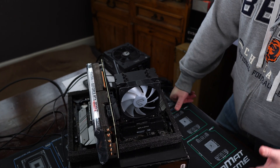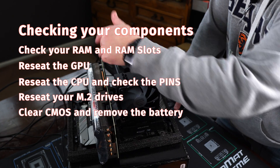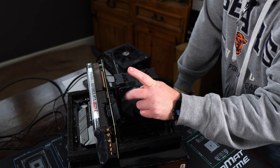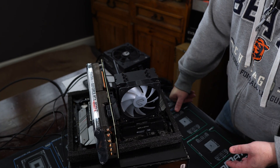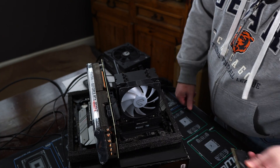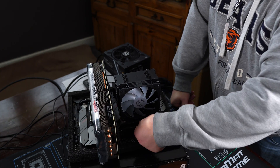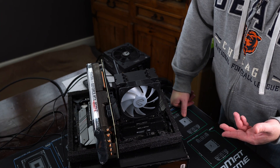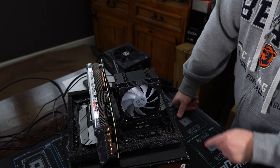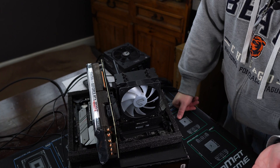Next up is checking whether it's a hardware issue rather than a cable issue. The first two easiest things to check are your GPU and your RAM. For RAM, reseat your sticks fully — take them out and reinstall until you hear that nice crunch. If that still doesn't work, take out all but one stick and leave it in the single-channel slot, usually the second slot away from the CPU cooler. Check your manual to be sure.